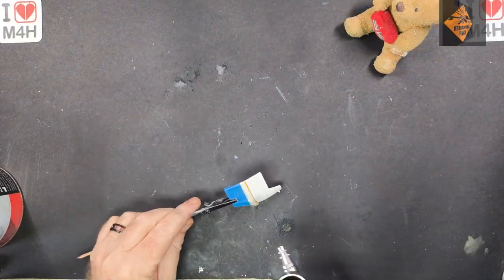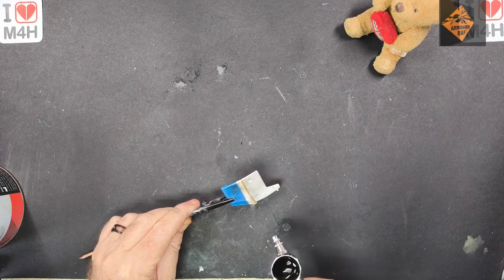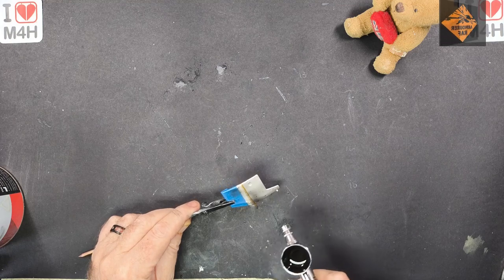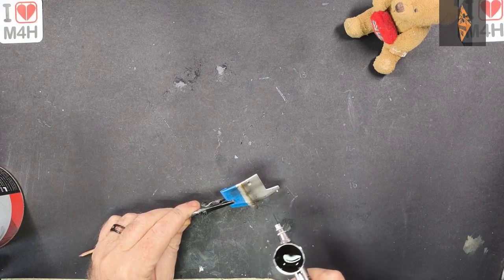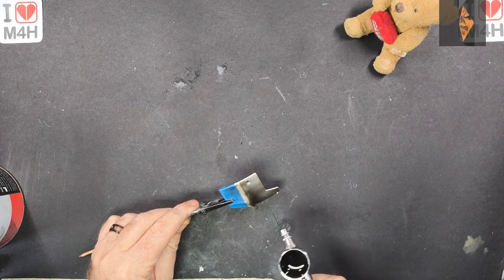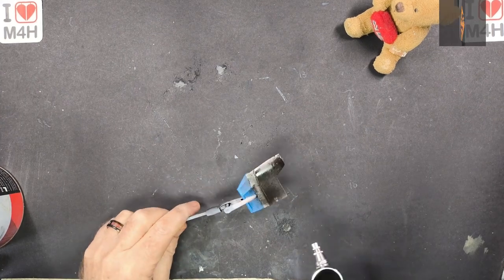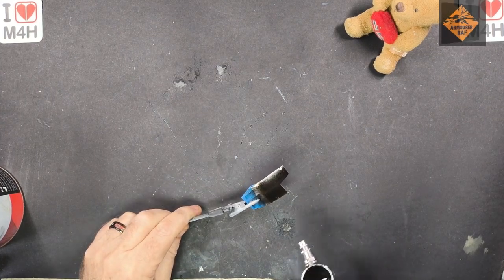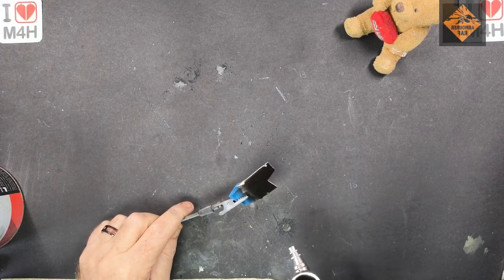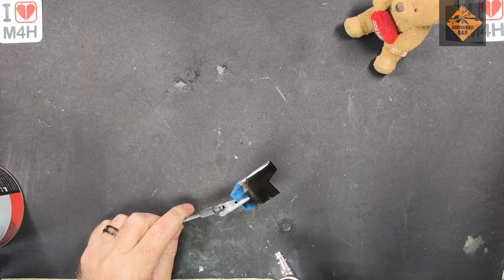To start this episode, we'll be spraying all the lower parts of the cab, ready for its main colour, which is going to be a candy colour. To do candy colours, you first prime. Next, a gloss black, then a shiny chrome, and then finally the candy colour. The gloss black gives depth to the chrome, which in turn gives depth to the candy colour. Obviously, this gives the colour even more depth, dependent on how many layers of candy colour you do.